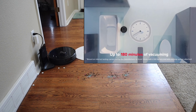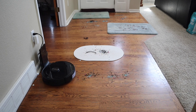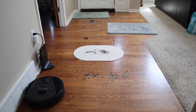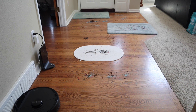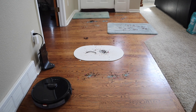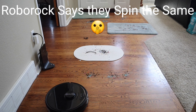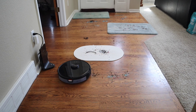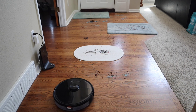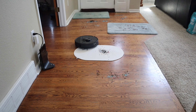Roborock redesigned its side brush — instead of having bristles, this time it actually uses silicone, as found on the S6 and S5 Max models. With this newly redesigned side brush, it's more durable. I've noticed the side brush holds up well even after 6 months of use. Also, the side brush is speed sensitive: along the baseboards it spins up, and in open areas it slows down. With this latest model, I did notice the side brush spins faster than on previous models. The stalling issue isn't really a big deal because once it does stop, the side brush picks up within a few seconds. Hopefully down the road Roborock may consider a dual side brush system — I like the dual side brush like on the Ecovacs T8 or the 360 model.